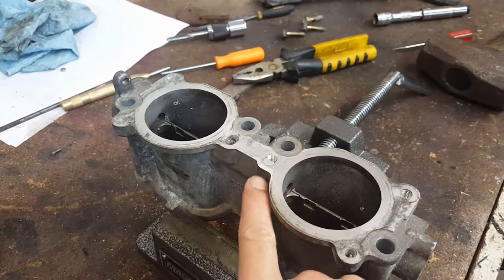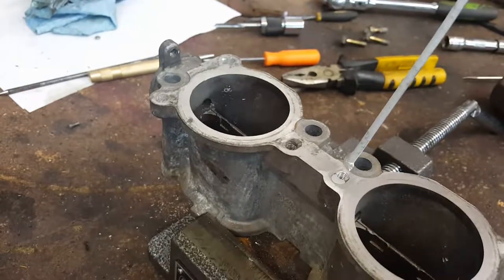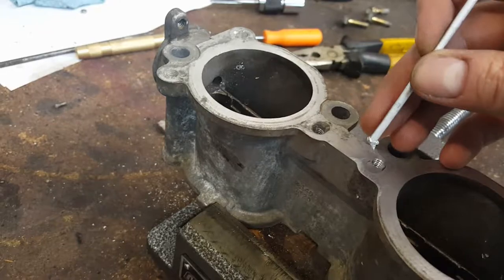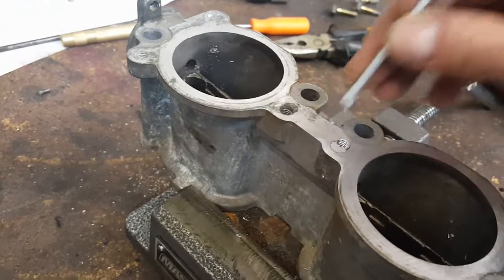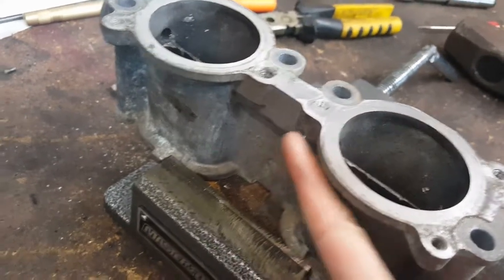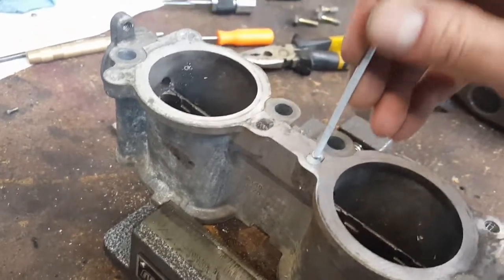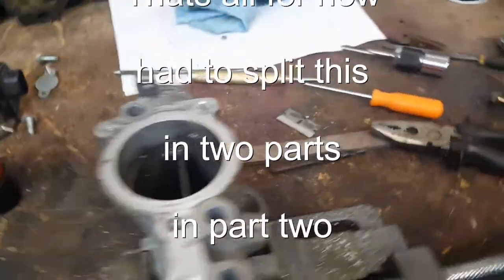You saw me heat up the body of the TGV, not the hole inside, because you want this thing to melt. If I were to hold the flame directly to the rod, then this would heat up, and this has a lower melting temperature than this aluminum body, and this would simply not stick. That's why I took the time and heat it up here from the side. So this whole thing was super hot, even on the edges here or here, but needed to reach that temperature, so this basically melted to the touch so it would stick properly, and it worked. It's good stuff, these aluminum rods.